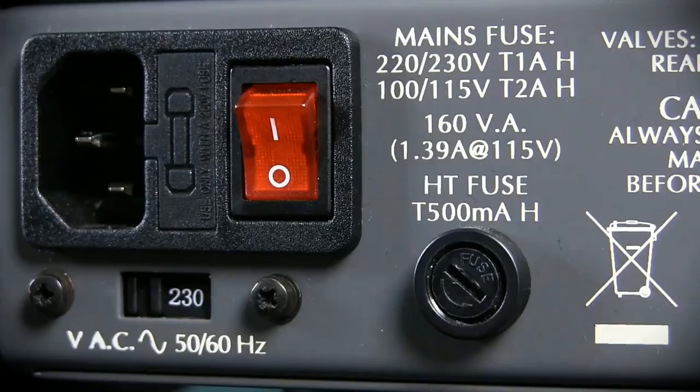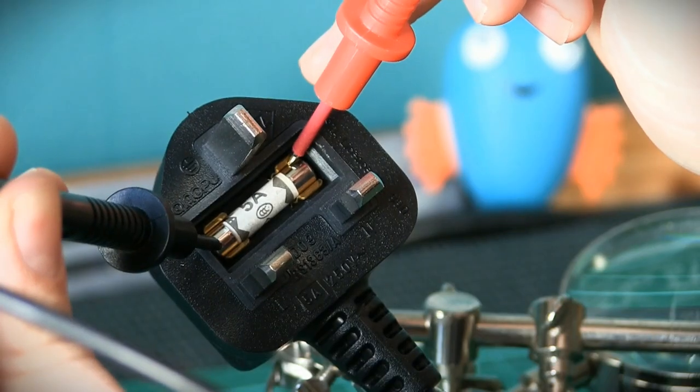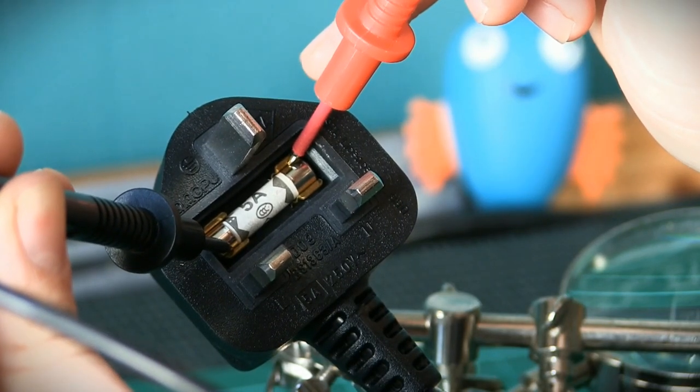Fuses. If you have everything plugged in and switched on but you're still not getting power to your amplifier or effects, then the likely cause is a blown fuse. Fuses can be located on the rear panel of your amplifier and, depending on where you live, inside the mains plug head. Probing both ends of the fuse will let you know if it's good or if it's blown. Remember to only use a fuse that's rated for your device. If your device continues to repeatedly blow fuses, then that means the device has developed a fault which requires repair by a qualified technician. Simply sticking in a higher rated fuse doesn't solve the problem — it means the fault will go unchecked, drawing more and more current from the supply until your device is damaged beyond repair or sets fire to itself and everything around it.